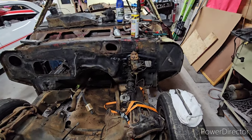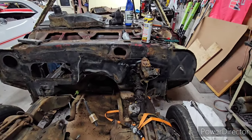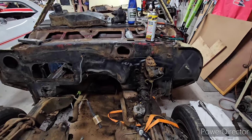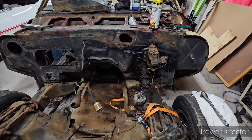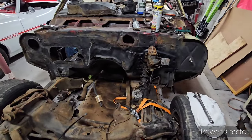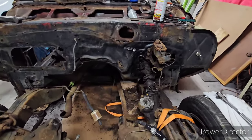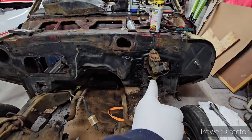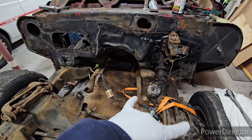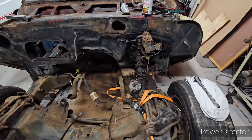Before this car gets touched anywhere else, I had to approach this. You will watch in the video how I did a whole bunch of hammer and dolly. I also used ratchet straps - one ratchet strap inside the car to pull this badly dented firewall. As bad as this was, it came out excellent. I won't tell you it came out perfect because I'd be lying, but it came out damn good compared to what it was. The steering shaft is now straight on that rag joint the way it's supposed to be, and when I turn the wheel lock to lock, the car does not have the hop anymore - she's turning nice and easy just the way it's supposed to.